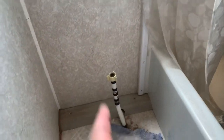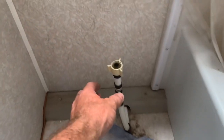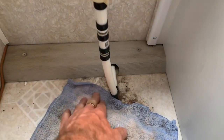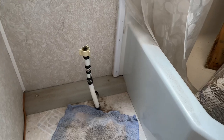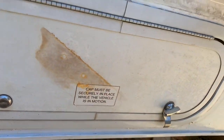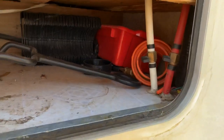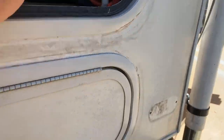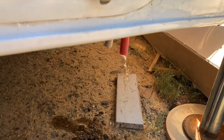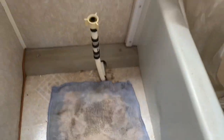You're going to want to turn your water off before you disconnect your toilet. You can see this pipe has water and it's kind of overflowing a little bit, so I'm going to go over to my low point drain and let all that water out so I don't have to keep mopping up the camper. The low point is in this storage compartment, so open that up and let those drain. I'll just leave them open until the water has drained out.